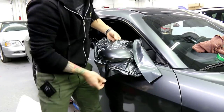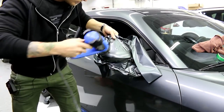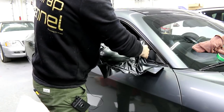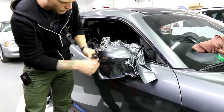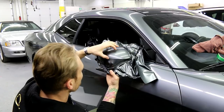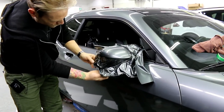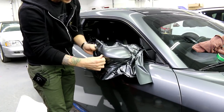What I want to do is make sure I don't have any wrinkles in there. I'm going to hold it out. We got some pretty good coverage as far as coming around the mirror goes. We need to just glass out these wrinkles. I'm going to come underneath and fix that up a little bit, come across and stretch it a bit — nothing crazy, just enough to get the wrinkles out. I don't want to add too much tension here. The whole purpose of this is to not add too much tension on the very tip of the mirror.